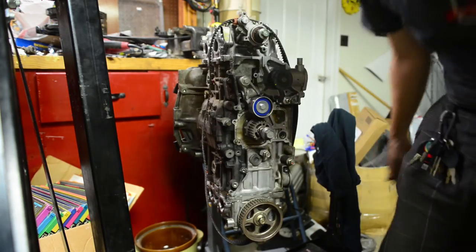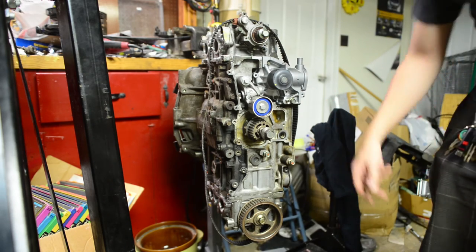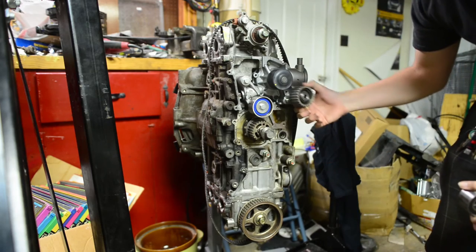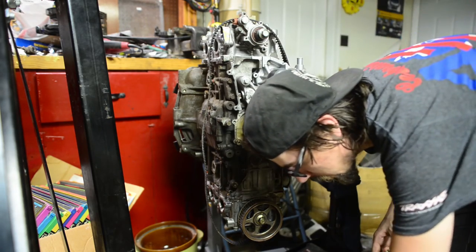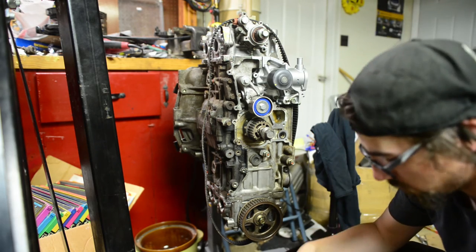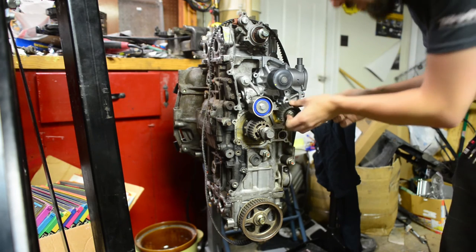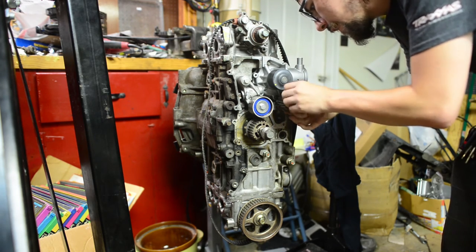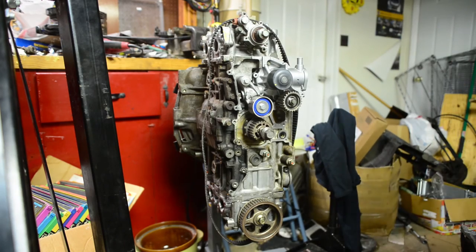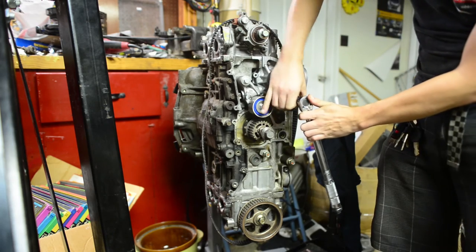28 foot-pounds. Okay, that leaves me three other bolts on the block. These are basically just for idlers, just pulleys that sit there and do nothing but spin. You get two round ones, which go, if I recall correctly, here. And then you've got a sprocket one, which goes here. Basically, they're on the long bolt. I've got all the bolts just tucked away in the block. So one by one, I'm just going to unthread the bolt that was there, put this guy back through, and start tightening them. These, I think, are 15s. No, they're 14s. 14 mil bolts all the way around, 28 foot-pounds all the way around.